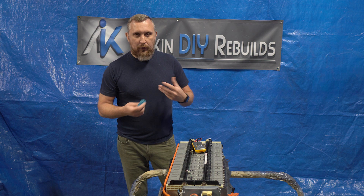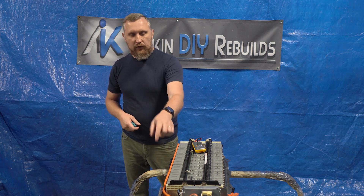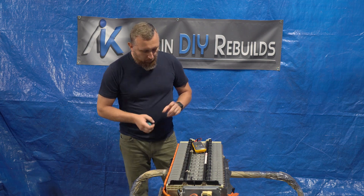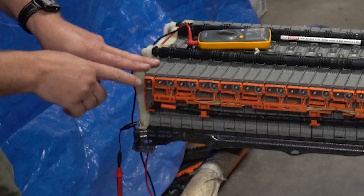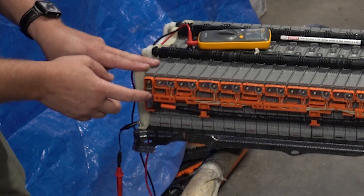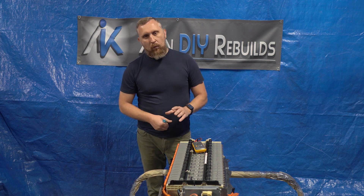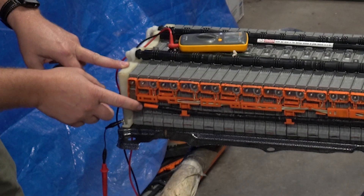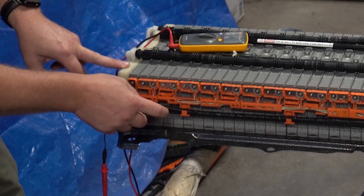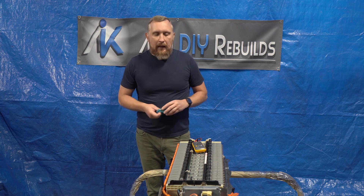Okay guys, so it's the next day — I ran out of time yesterday. I didn't find any breakage or anything that would indicate a shortage between the cable and the shield. This shield is actually grounded to the base of the battery. But I found a small green corrosion puddle — this terminal right here was corroded pretty bad. The only thing I can think of as the reason why this cable was shorting to ground is because of that corrosion. I think that fluid started leaking and went down the cable, and the shortage happened that way — from the terminal to the shield. That's the only thing that I can make sense out of.